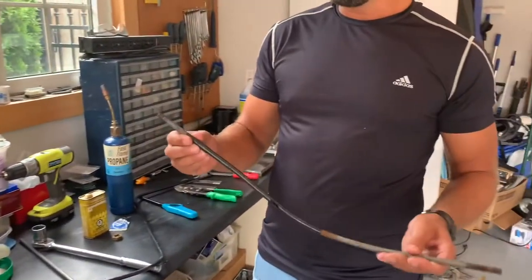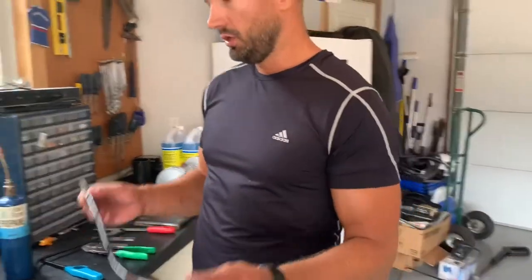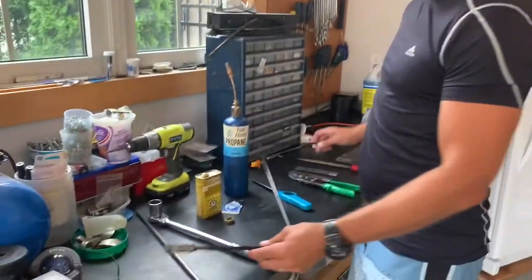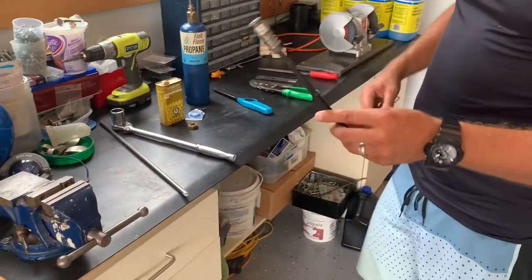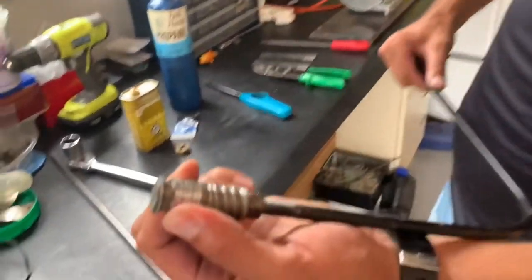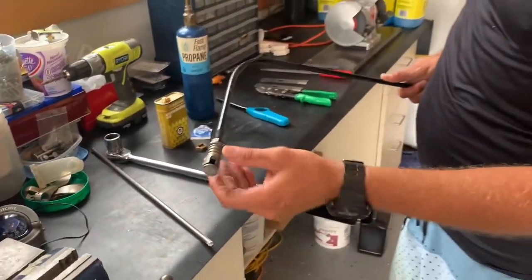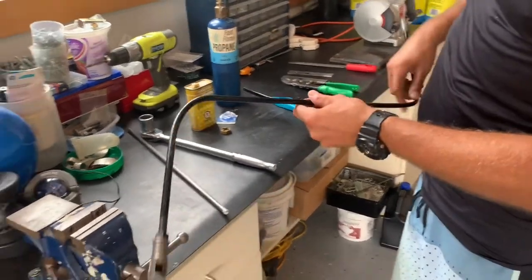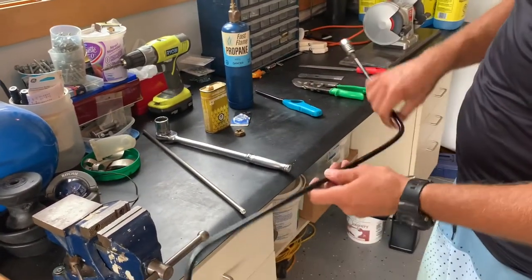This was actually the original one we got with the boat. As you can see it's very short — we had no way to connect it because it didn't reach from one motor to the other, and obviously some missing parts. But you can see it's threaded on the two ends. This one was bent and wrapped in tape, so we made a much more sophisticated one that follows the shape of the boat so that with the offset motor it works a little bit better. It's got quick release ball joints on the end that allow you to quickly pull it off and connect it to the ball joints on both motors, with a nut to hold it in place. I put a coat of paint on it just to prevent rusting — that hasn't helped that much so we might have to do something else there.